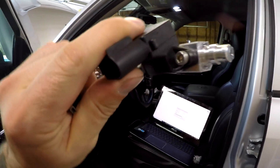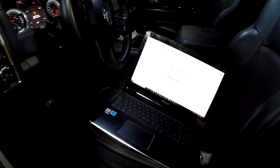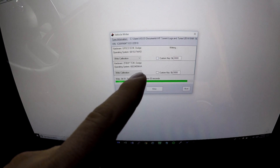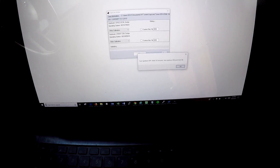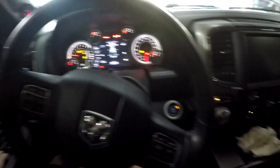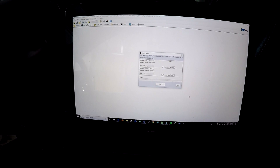If this all loads with no errors, we're good to move to the next step — installing the injectors. We also have a larger 3-bar MAP sensor for boost, since the stock one isn't capable of reading boost. That'll be in the next video. Right now it's writing to the ECM — the engine side — and it's almost 100% done before it moves on to the TCM, which is the transmission control module. It seems to be going smoothly.